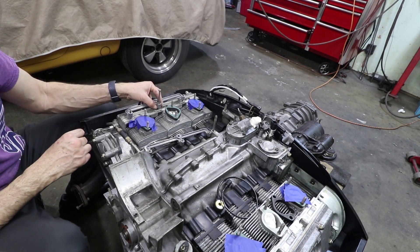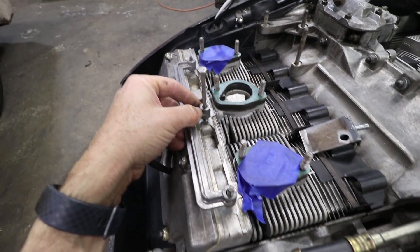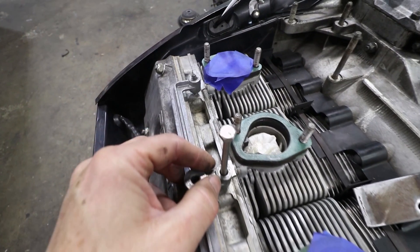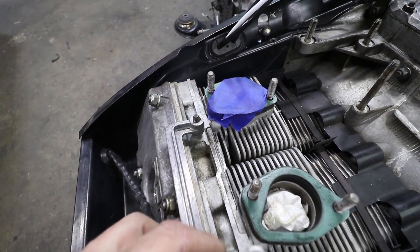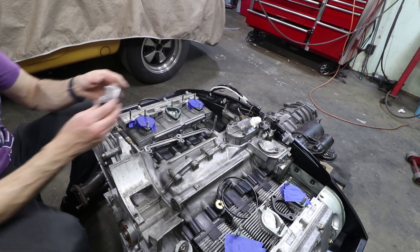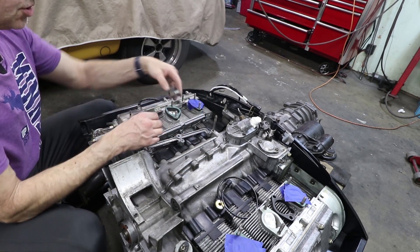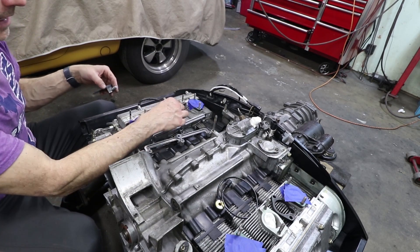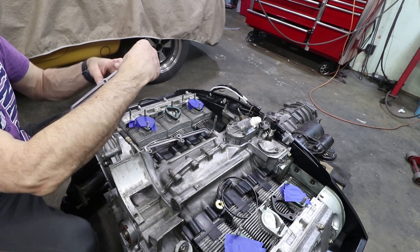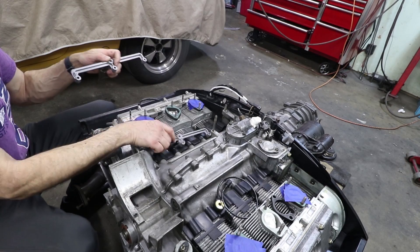These seem to be good original parts with a sloppy fit, which is okay — this doesn't need to be a high-tolerance fit, but we do want to drill the holes right in the center. My thought was to make a little template, and I've already welded together this little bracket that's going to allow me to work off the intake stud to locate this bracket and tighten it down. Then I'll make some drill bushings and we can drill it in place.